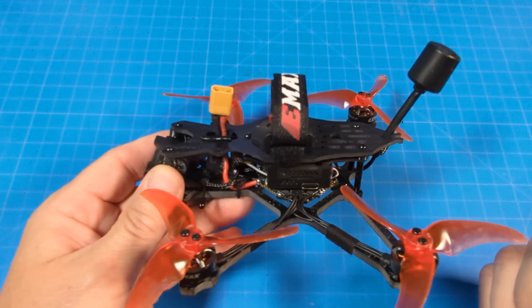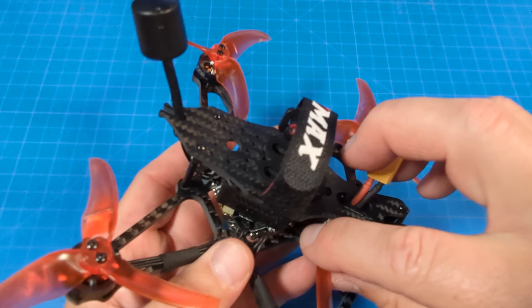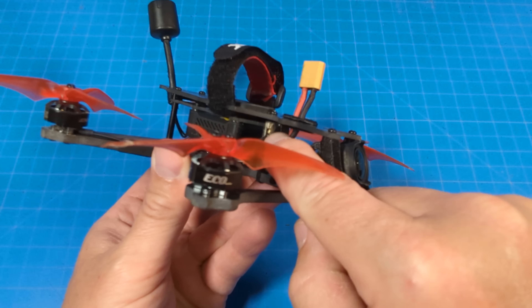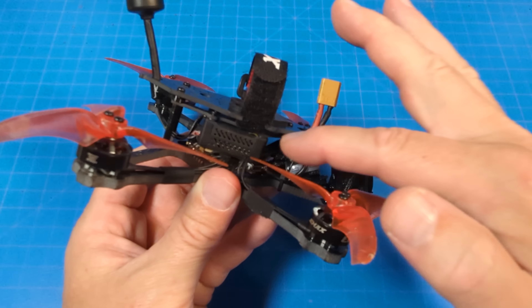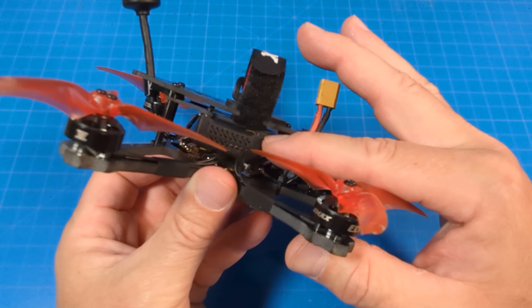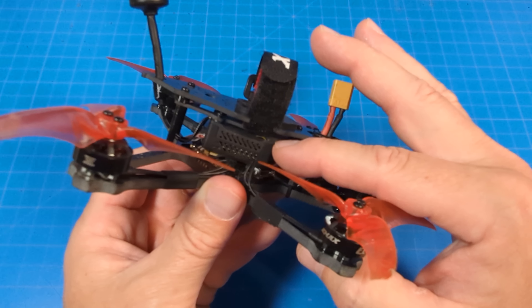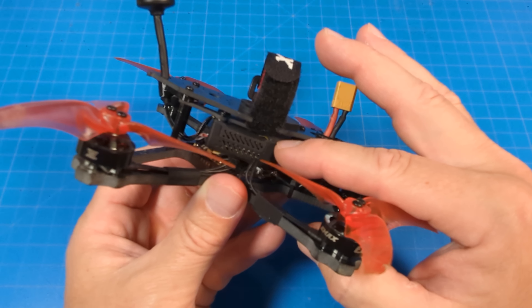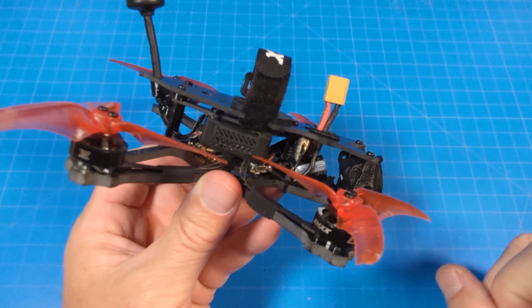There's a little holster built into the mount for the receiver. Also note there are two plates with a washer between them — when you take this apart, that washer is one of those things that will fall and could get away from you. So do note that little washer when disassembling to avoid losing it.